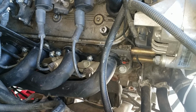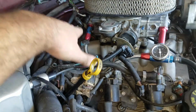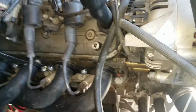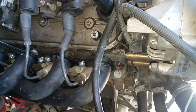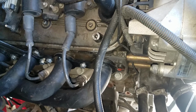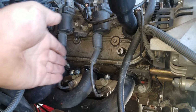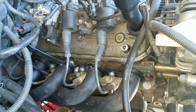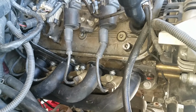And I did want to move the engine forward because I thought it'd give me more room back here, but actually I have plenty of room back here. And it was perfect. When I put the transmission in, it was a lot easier, since I have the 1-inch setback. It's where the motor's originally located. Because if I would have moved the engine forward, I would have had to tuck the transmission back underneath the tunnel a little bit further. But either way, I think it would have worked. But 1-inch setback is not an issue.